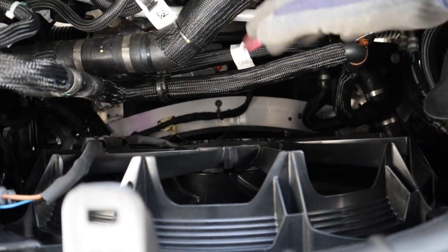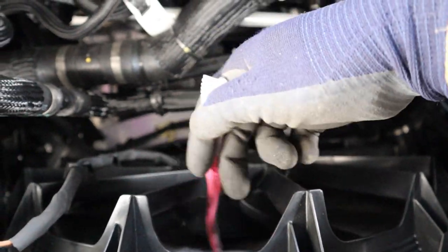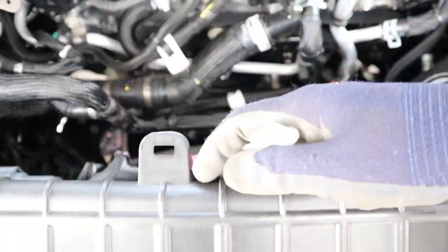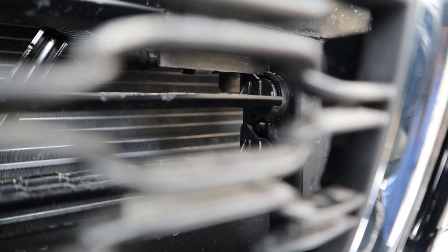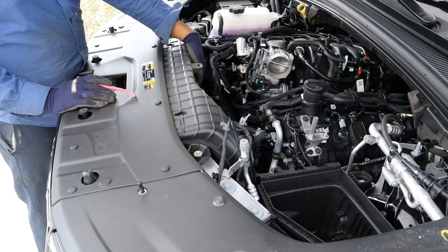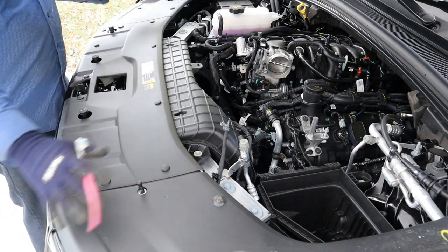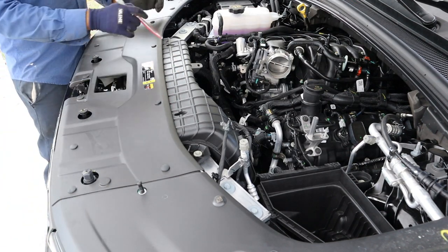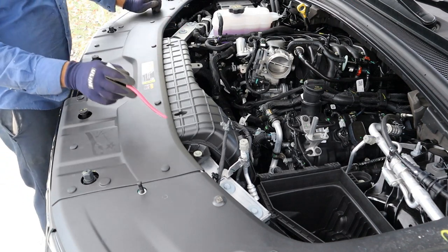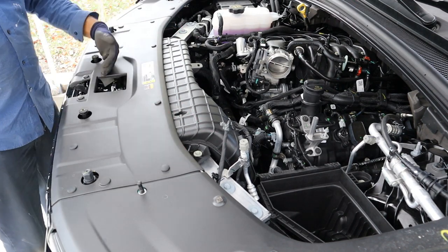Take a look at how much space there is between the engine and the cooling fan. The cooling fan is pretty standard — one giant plastic fan connected just behind the radiator. Looking up at the front there are active grille shutters. Unfortunately, no matter how much room you have back there, to change the radiator or even the condenser you're going to need to remove the front fascia as well as the radiator support. Speaking of the radiator support, it is made of extruded aluminum, which I like, and it'll just bolt right off — but it's still a lot of work to get to that radiator and condenser.